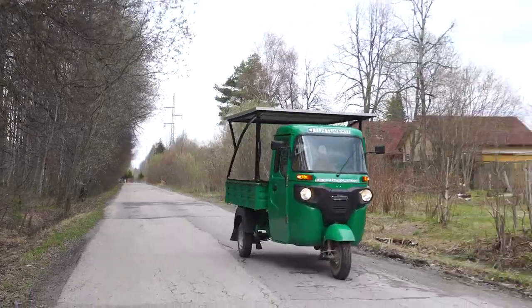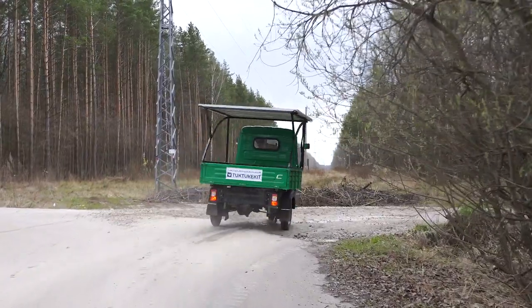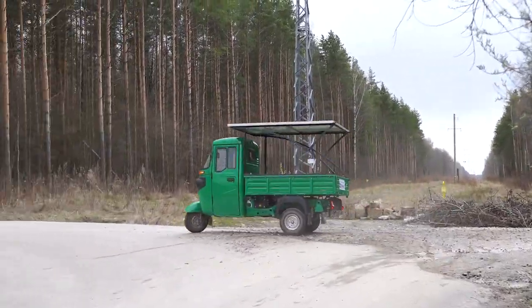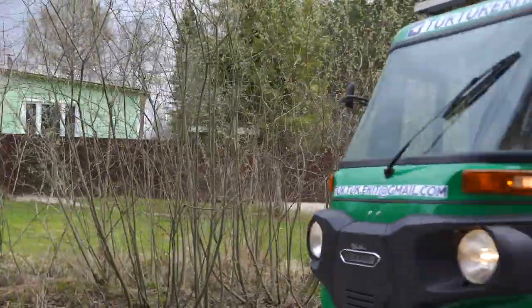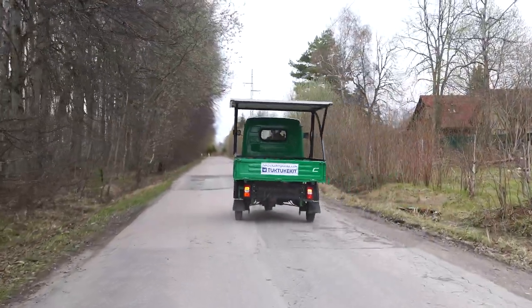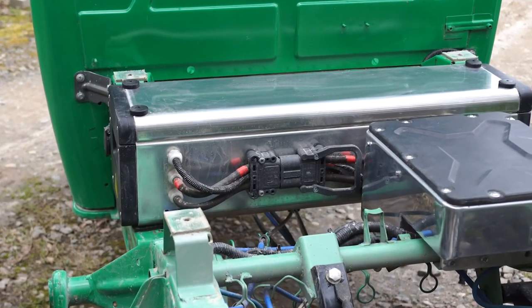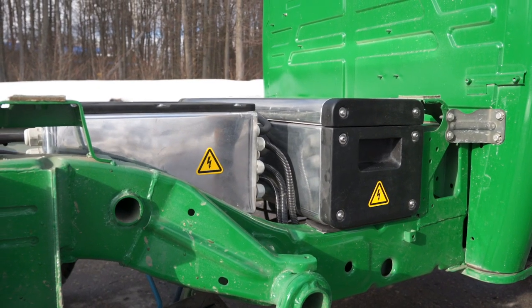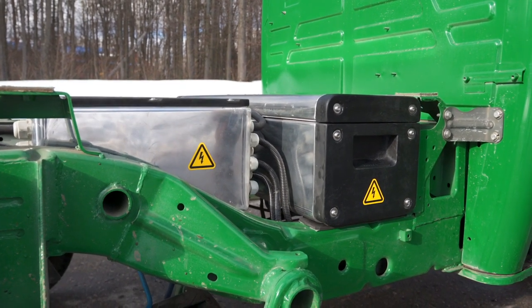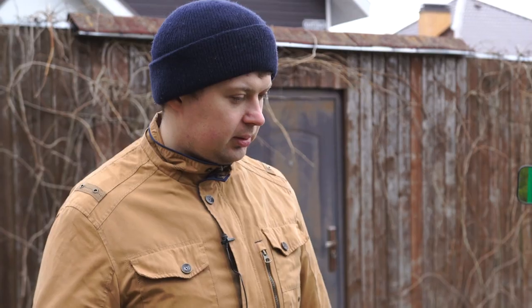You see, the box is so huge it could fit a 100 Ah battery. But the reference point is that this space can be fully occupied by the lead battery, and this space can fit a maximum of 50–60 Ah at a given voltage of 72 V. We will calculate the mileage for this capacity.